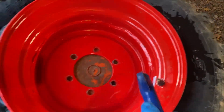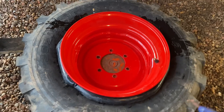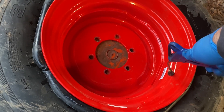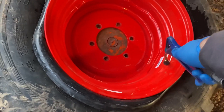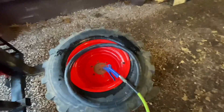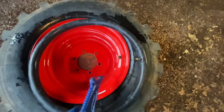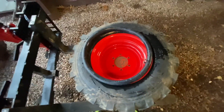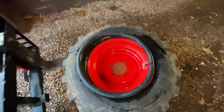The trick is to get air in here, pull the inner tube out, and put the valve core back in when that top bead seats. I got to do this two-handed. I got it seated. What you missed: I put air in with my blow gun, it forces the tube out — the tube pops out. Keep giving it air, don't give up, it'll pop that bead back in. Then you shove the core back in and now you can put in air normally.